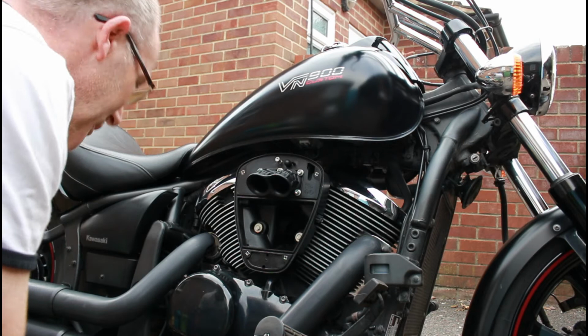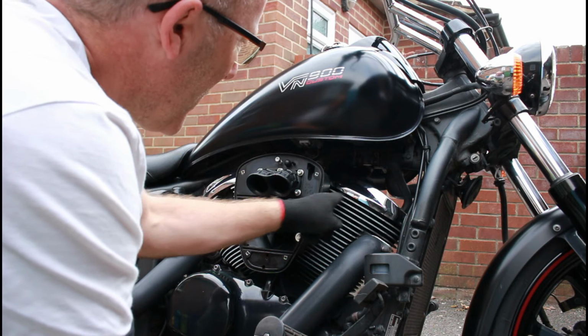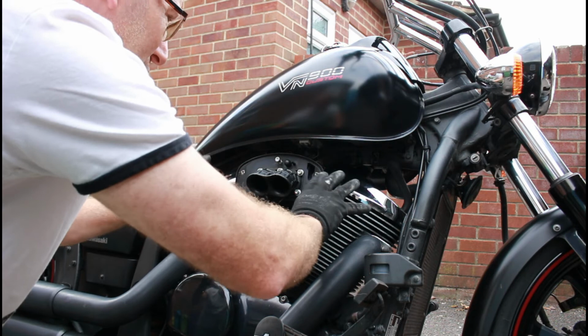And that's it really. All looks good, all looks fine. Incidentally, if I ever want to spray this part and clean these fins, then obviously I would undo these bolts and undo this section and undo these clamps, etc., and take this plastic housing off of here, along with that breather that runs up underneath there somewhere. Take that off, and then I've got the two cylinder cases exposed.